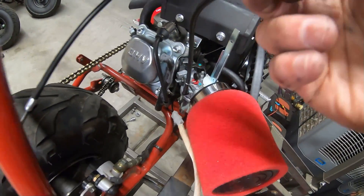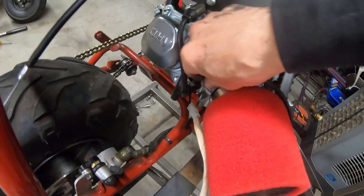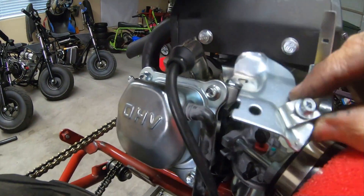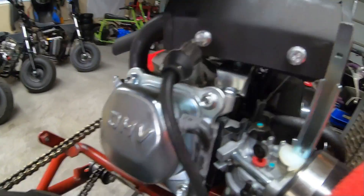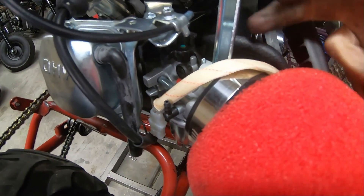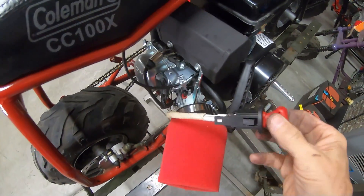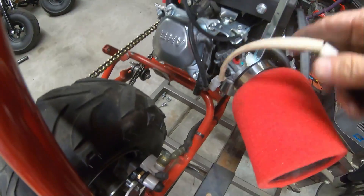This thing has a primer pump on the carburetor to pump fuel up for the snowblower to prime it — they don't actually need it, so I'm just going to pop it off. To get the throttle to work, I'm going to use a throttle plate off a Predator — or at least half a throttle plate. I think the entire Predator throttle plate will fit if the stock exhaust is removed and you just use a Predator exhaust. I just ran a couple of zip ties on here to make a quick throttle. That looks like it works out pretty good. If I was going to keep this engine on here, I'd do a more permanent throttle setup, but that'll work for now. I'll keep this kill switch on here for now — if I was going to keep this engine on the bike, I would wire it up properly, but this will work just to get it started.